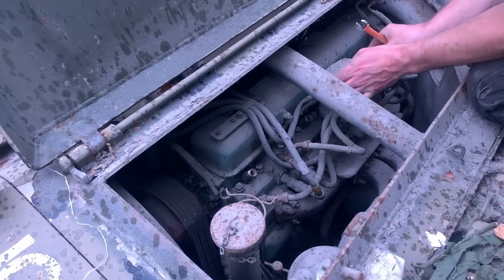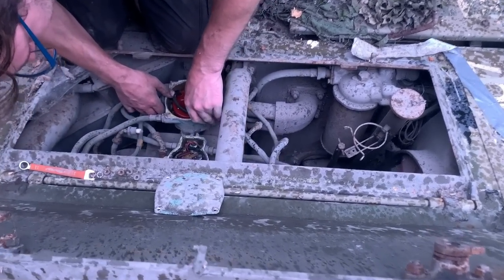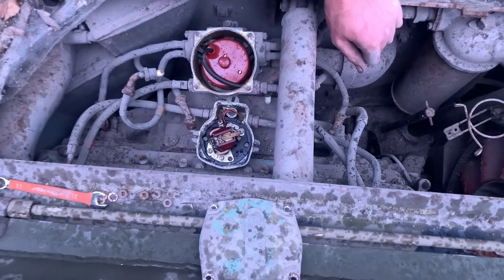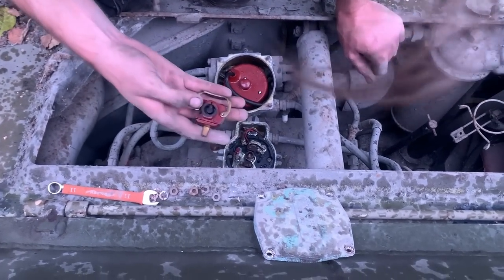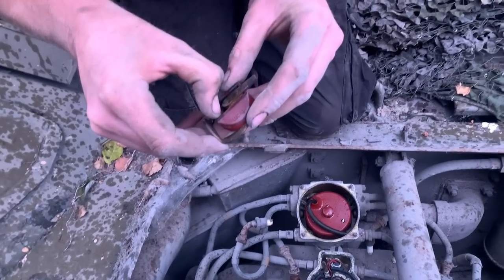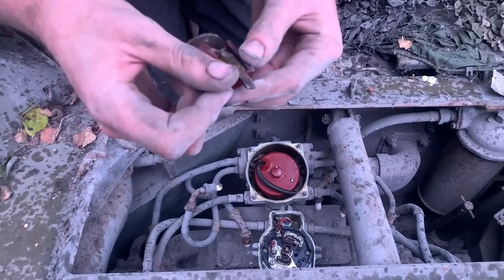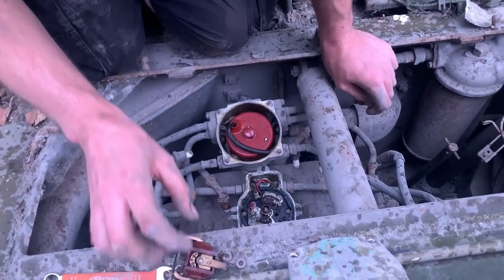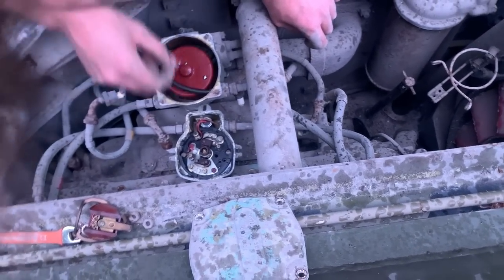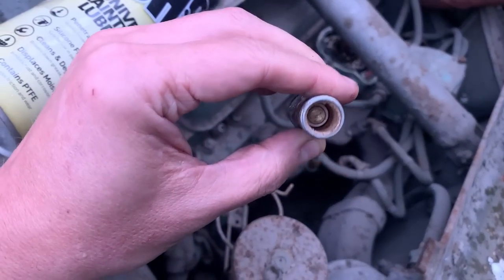Nice screwdrivers. One weird looking rotor arm with a limiter on it. That's your governor limiter. I wonder if you can order them. No. Unfortunately, that is it. That's what David told me about at work. It's got two sets of points. You've only got three lobes on the cam, whereas normally on a six cylinder you'd have six. With this, you've only got three, with two sets of points, and it's doubled up. Yes, they are unusual looking.